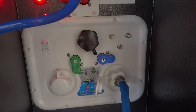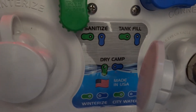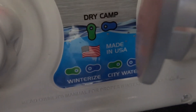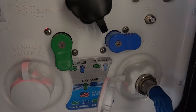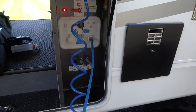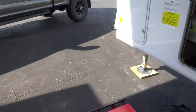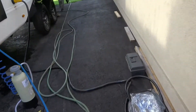I flipped this blue switch downwards and, as you can see, that's not one of the labeled options. It's either green to the left, blue down for sanitize, green to the left, blue down for tank fill, dry camp with green down and blue to the right. When I flicked the blue switch downwards, I heard a sound and that seemed to have solved the problem. I did it for about 10 seconds, flicked it back up, heard the pump going, it made a louder sound and stopped. I went inside, turned the water on and it worked — it primed the pump for some reason.